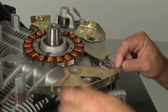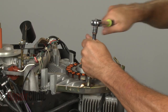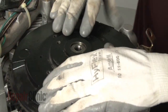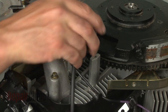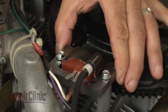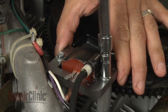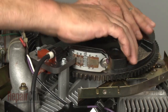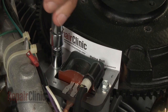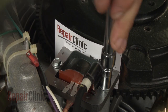Replace the backing plate and secure the bolts. Reposition the flywheel by aligning the slot in the flywheel with the flywheel key and sliding it onto the crankshaft. Now reposition both ignition coils and insert the mounting bolts. Pull the coils back and tighten the bolts. Now rotate the flywheel so the magnets align with the coil. Insert a business card and loosen the bolts to align the coil the correct distance from the flywheel. Re-tighten the bolts and remove the business card.